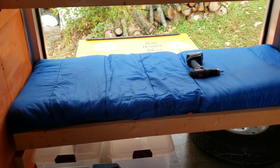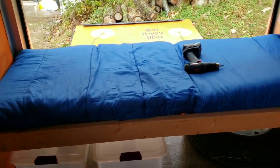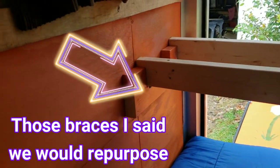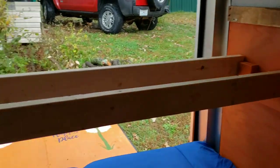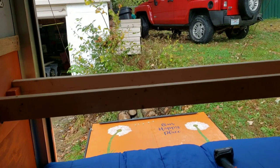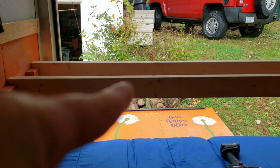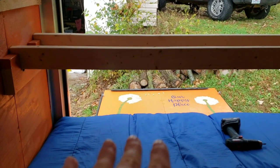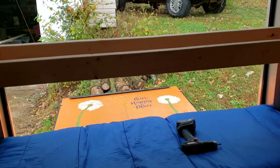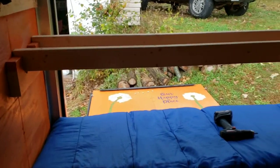All right, so our first bunk as you can see is in, and the mattress that we were using — we were using two split mattresses before — fit in there perfectly. We did add some ply board across our base there so that it doesn't let the bedding slip down through the slats. We have the braces up for bed number two now; we just got to put the cross beams on and give it its lip. What we're hoping to be able to do while we are camping is to pull this top one off and set it down on the bottom one so that we have a couch during the day. That is kind of our mission. So we will keep working here and show you what it looks like when it's done.